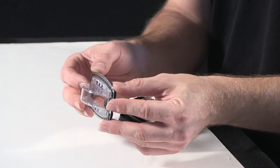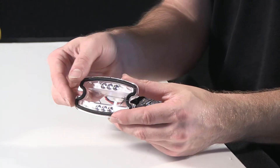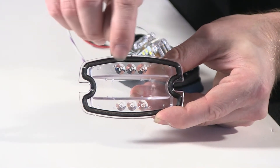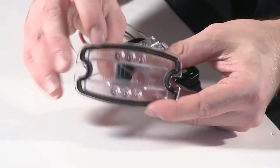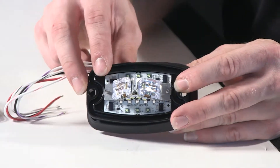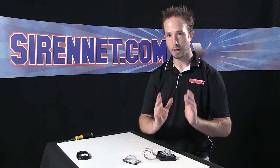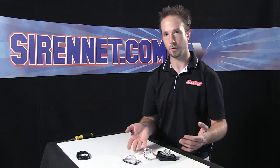What's important to note on this polycarbonate front housing is that it contains optics. On the back of the unit, you can see that you have a total of three little dish points built into the optic — three on the top, three on the bottom. Those act as an intensity booster for the diodes mounted inside the V23, in a row of three on the top and a row of three on the bottom. They take the diodes and help to direct and focus their intensity so you have a more focused takedown, spot, or alley light function, depending on your application.